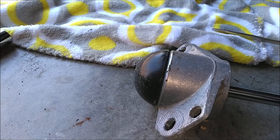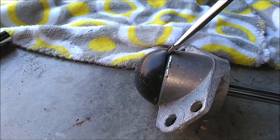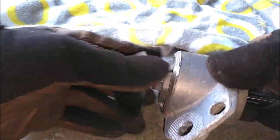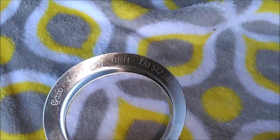All right, the next step is to pop this plastic cap off the top. Just get a screwdriver underneath here, and you can see it separates, and just pull it off with your hands. Okay, the first item I'm going to install is this lower spring perch. You can see the part number right there. I'll have it written in the description as well.